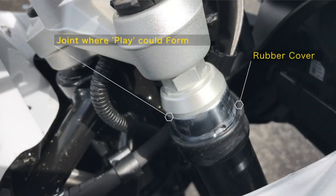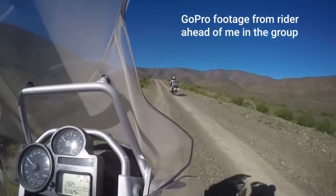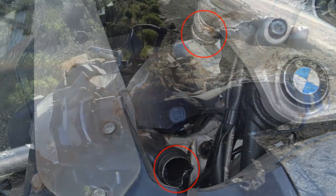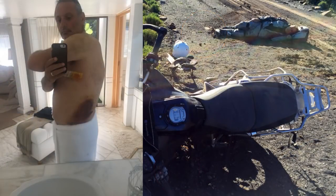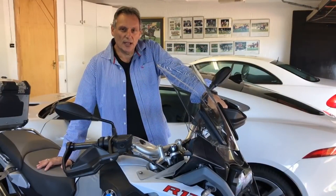There's a little bit of play that can happen in the joint of the press-fitted fork stanchion plug. It locates in a rubber bush at the top of the yoke, and that's starting to generate some play between itself and the top of the stanchion tube. You can see there's a rubber cover that covers that joint — and that joint is the issue. This all started from a motorcycle enthusiast called Tony, who filmed a video that's free on YouTube. He was riding his motorbike and his fork just tore apart while riding, and he fell down.